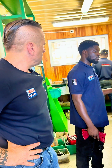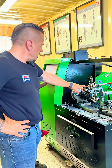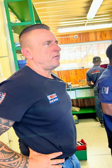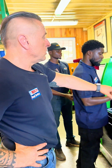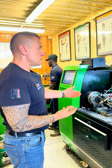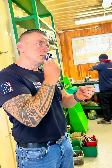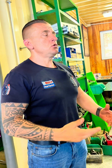This one — the sound is okay. You see it will make our fluid dirty. Well, this one is still alive — I can say it's still alive. It's not perfect but it's alive. We can do a longer test after this. Right now we do the backflow test — those that are leaking straight away like a pipe — but these ones we will do an additional full cycle test to see pre-injection and all the cycles.